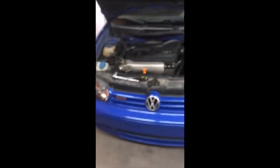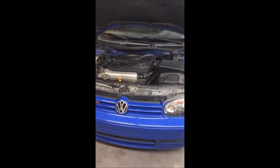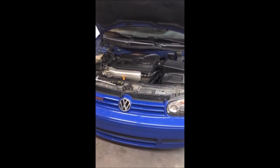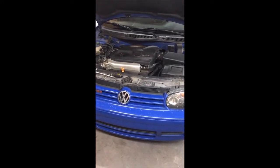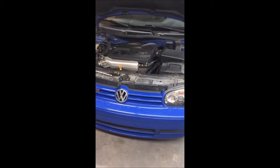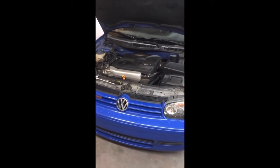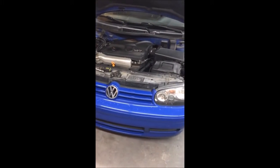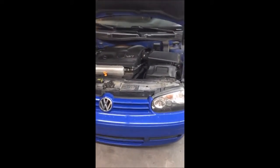The only performance difference that I've seen since I've had this particular engine light is a slight dip in idling RPMs. It'll drop maybe 50 to 75 RPM, like a really quick dip, we're talking like a second. It'll dip and then go back to its original idle, so it's just a very intermittent rough idle. I have not ruled out the possibility of a vacuum leak, but this is the code that the car is throwing, and I do have the new part here, so we're going to go ahead and replace that today.